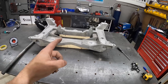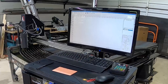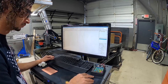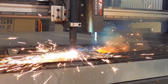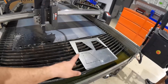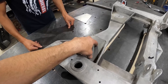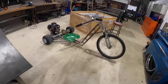First we need to cut some washers and plates on the plasma table. Poly is cutting eighth-inch material — a little more stout than what we'd normally use — to give us the ability to make some really nice brackets. For the Tesla motor mounts we'll use quarter-inch material, but right now we're making our motor mount base plates out of the eighth-inch stuff. These plates are going to act as the points where we can start welding everything off of.